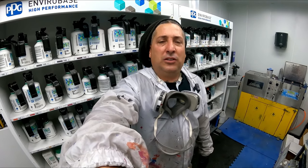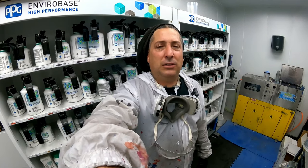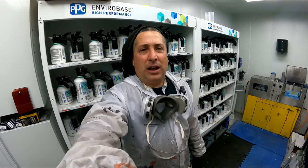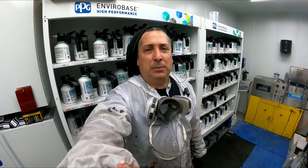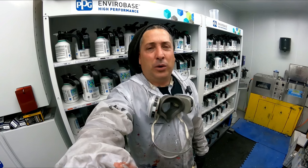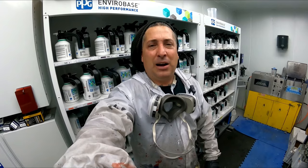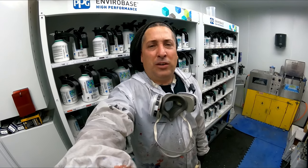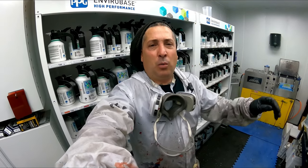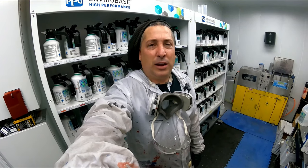So this is a good sealer, but it definitely has a little bit of grain in it like most sealers do. And to me, it has a little more than the actual Sherwin-Williams does. So I wanted to make sure this job comes out as clean as it can, because this is a brand new BMW with a hood job. And you guys know we don't like polishing, but if we have to, we will. But we definitely want to try to get them as clean as we can. That way we can get them in and out. So we wet bedded it, and we'll move into our base, and then we'll see how it comes out cleared. And we'll look at both jobs, one that was sealed and one that wasn't, and see if we can see a difference in it. So let's go ahead and move into it.